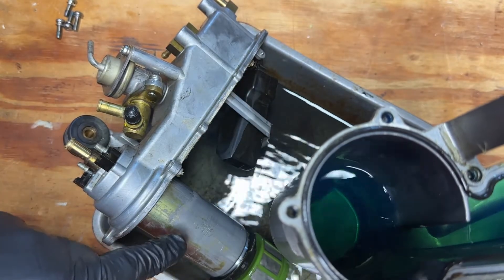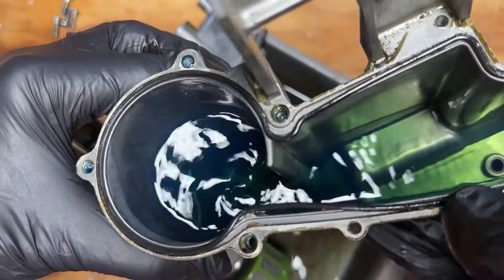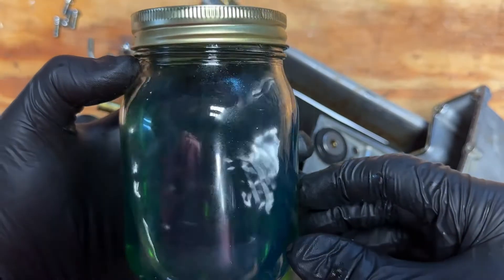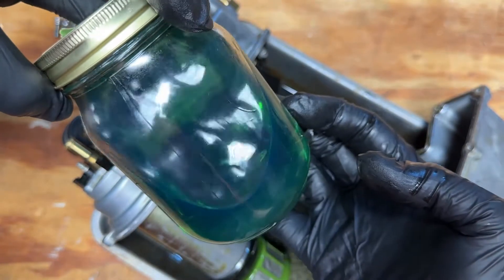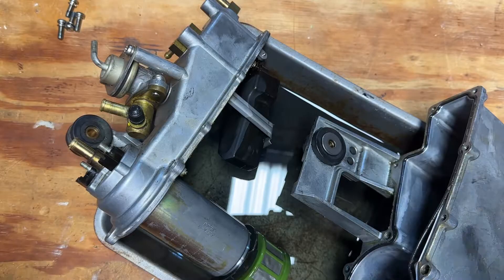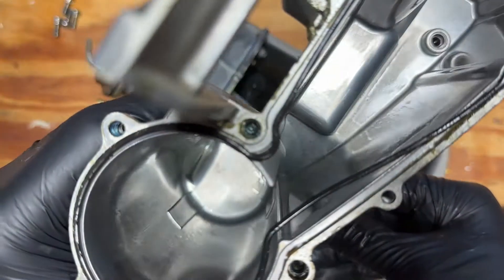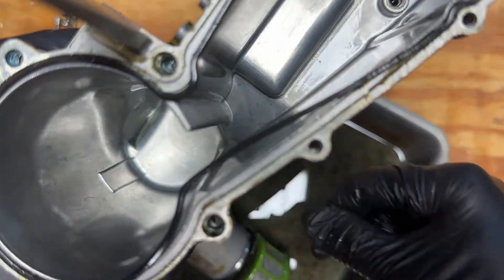There's our fuel pump. Let's look at the gas — there's a little bit of dirt and debris floating around in it. The color is just from the fuel additive I've added. Down in the bottom there's a little bit of dirt we'll clean out. I'm going to dump this into a separate jar to get a better look, and then take out that screw to clean out the bottom a bit better.